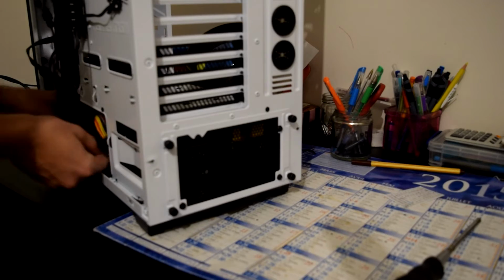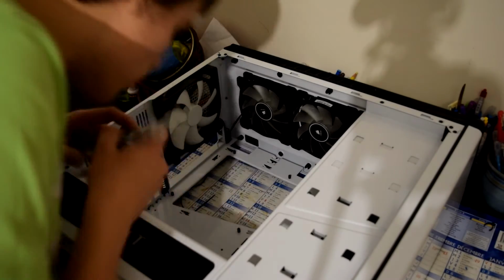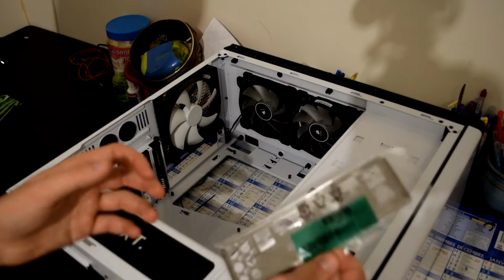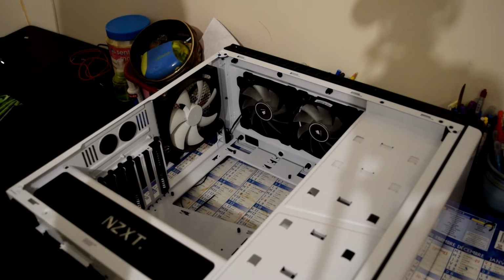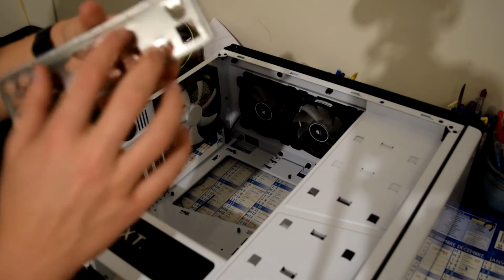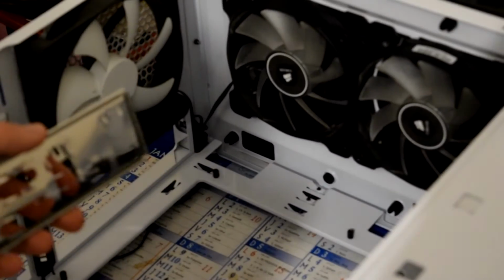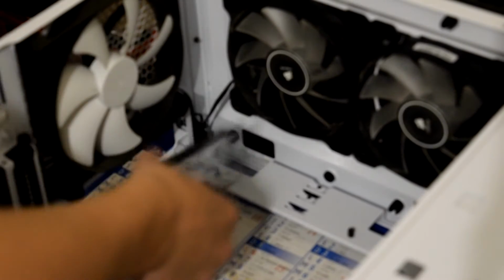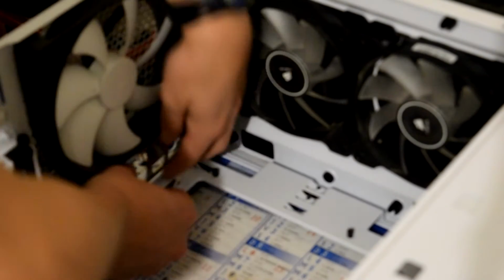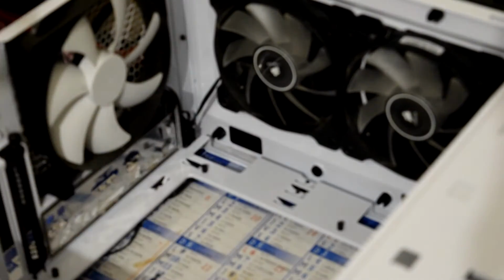And then now I'm going to go and install the motherboard, because I've already done the CPU. Before you put the motherboard in, check you have all your standoffs in, and I have a fake standoff on this. Then get your IO shield from your motherboard box. It should be there. If not, you might need to see if you can get a new one. Throw the rubbish on the floor, and then place it this way so that all these sticky out bits are facing inwards into the case. So there, like that. And then put it in, positioned the right way around, generally with audio IO at the bottom and the PS2 port bits at the top. Click it, push it in, check it's all pushed in properly, and then that's done.